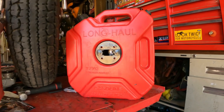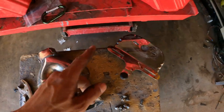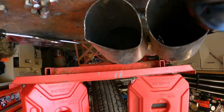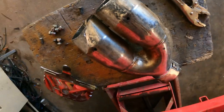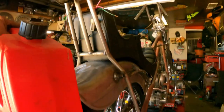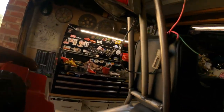What I'm going to try to do is use an old license plate mount for the Fat Bobs and cut off a piece so that I have the same circumference to mount this to. I'll either cut one of the tips off and weld a plate to it so I can attach it like this — or something like that. This is what I'm going to use for the backing plate. It'll basically go to here like that, and then this goes to here. So the basic concept is that my gas tank will still be on the bike but not on the bike. It's kind of awkward for me to hold the camera and show you all at the moment.